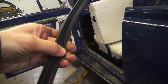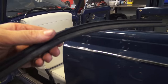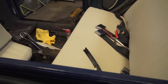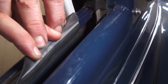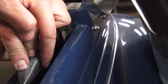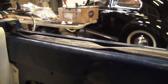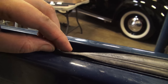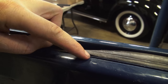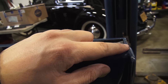Here's the inside scraper — we're going to do this job first. The inside scraper has a lip on the bottom that hooks right here where I'm pointing. You're going to want to wedge the rubber down and hook it underneath there, just like this. Get a little WD-40 and you can start moving this all into place, massaging it in. You need to do this with the window out, and before you put the outside scraper in — it just makes the job a lot easier. Move it up into place and then pull it up; there's another lip that inserts into this groove. Get some more WD-40, clean out that groove, and start inserting and pressing into that section.